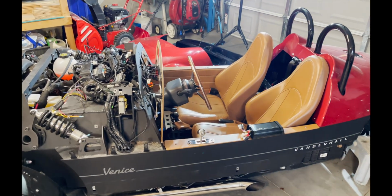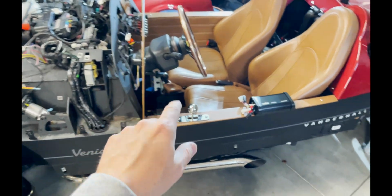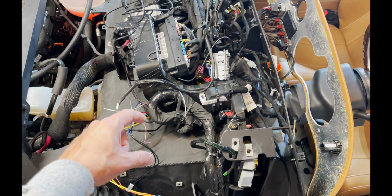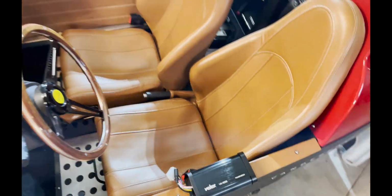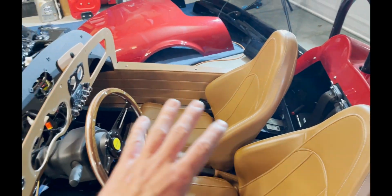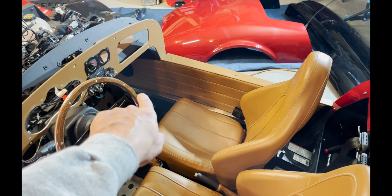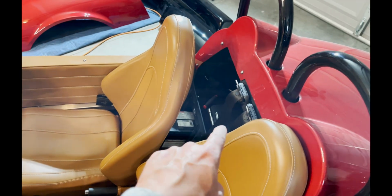Okay guys, from here I recommend that you don't mess with any of the wires until everything else is in its place. Meaning, I'm gonna take the new amp and mount it where the old amp was, but I'm gonna have to put a couple more screws in there because they're not lining up with the screws on the new amp. And then I'm gonna get the powered subwoofer in the back, and I'm gonna get all the wires laid out. Part of the reason I'm doing that is because I am not using RCA cables to connect the head unit to the amp, to the powered sub.